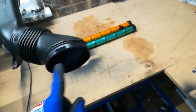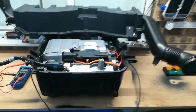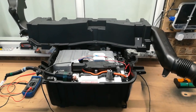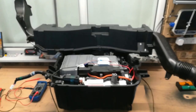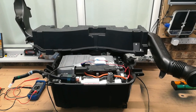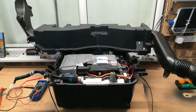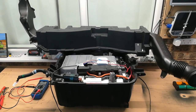If you've got a smoke can, you could put some smoke in the fan here — it'll blow in and you should see it come out the other end as it passes through the battery pack. You should notice significant improvement after doing this procedure. If you have any questions, there is a thread on the CRZ forum. Just take your time, be careful, wear your rubber gloves, check things with the meter, and good luck with resurrecting your CRZ nickel metal hydride pack.